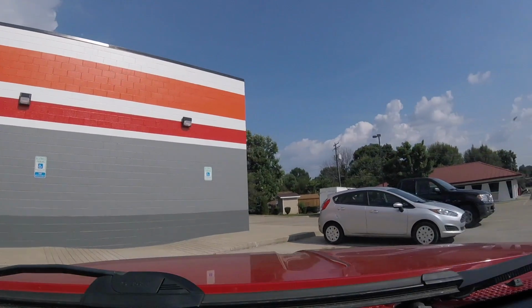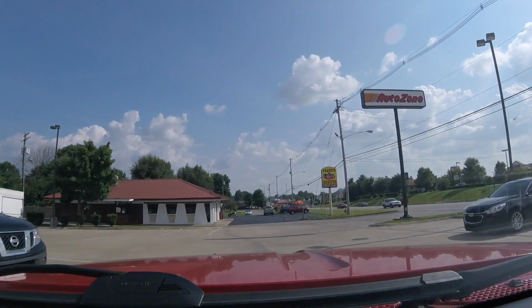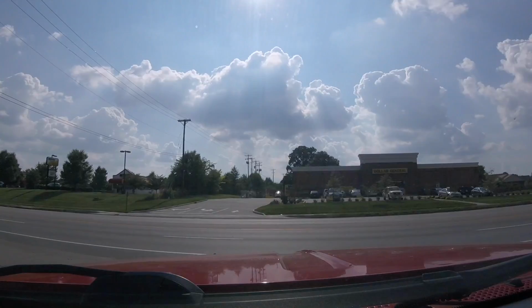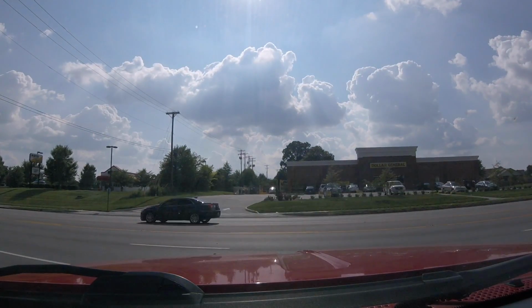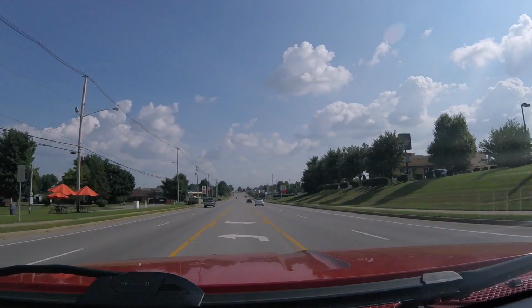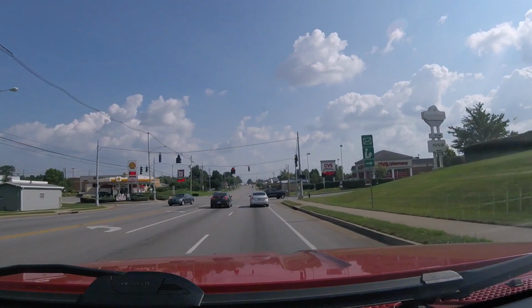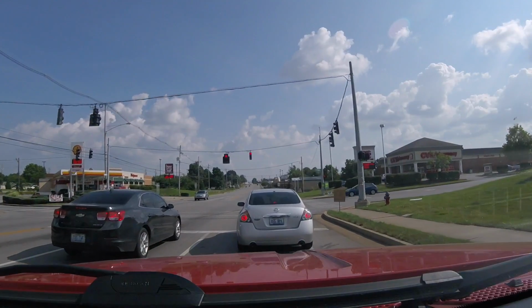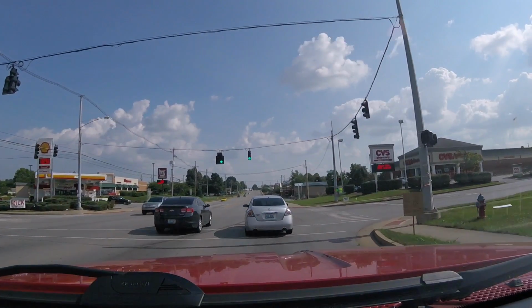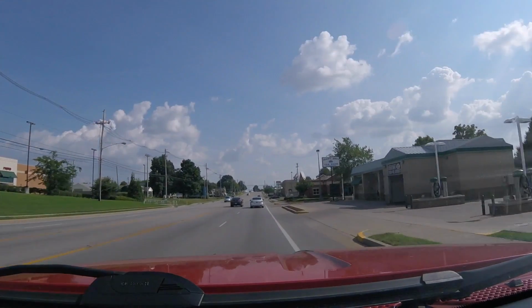Now it's off to get some gasoline. I like to get the 91 octane gasoline for my lawn equipment because, theoretically anyway, it's not supposed to have any ethanol in it. And the ethanol in the fuel is what makes it go south quickly. If you're buying fuel for your lawn tractor and stuff, chances are it's going to stay in your garage all season, maybe even into the next season. You don't want your gasoline to get fouled up. So I buy 91 octane with that in mind, and over the years I haven't had any problems, so I stick with what works.